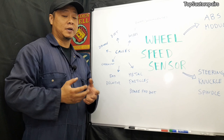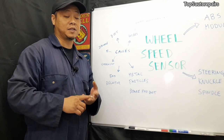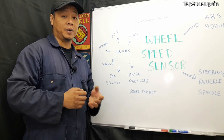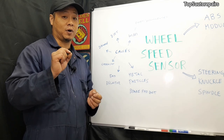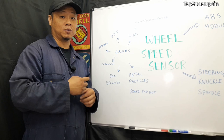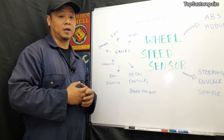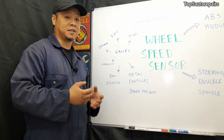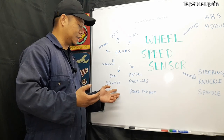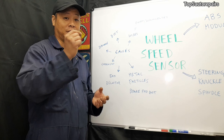The next issue is not that common, but I have noticed the reluctor can go bad — whether on the axle or on the hub bearing. I've seen small rocks get caught in the reluctor, and when it's rotating it cannot produce the signal that the wheel speed sensor is looking for. That causes an interruption in the signal and triggers the ABS light. You'll get a wheel speed sensor code even though the sensor itself may not be faulty — most likely it's a bad reluctor with a pebble or rock stuck between the teeth.